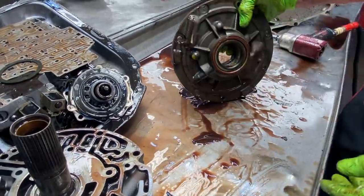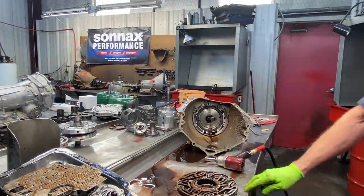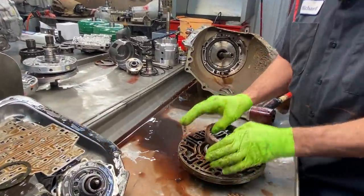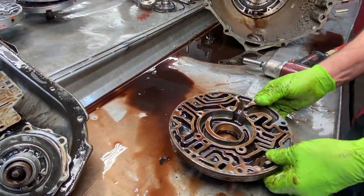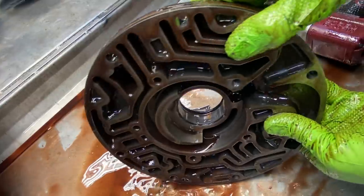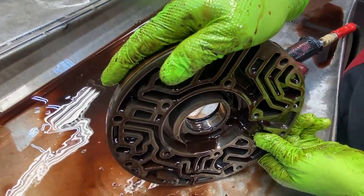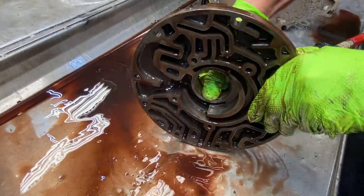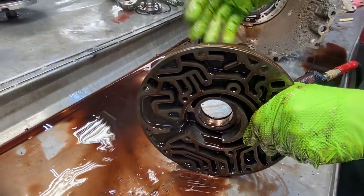This truck has got a big old 454 motor — 266,000 miles on it. We know the motor's got a lot of wear. Now look at this pump bushing — look how wiped out it is on the bottom, then come over here on the top and it looks almost brand new. That tells me the crankshaft is sitting really low in the motor, that the main bearings are worn out. The crank is coming down and pushing on this pump bushing. The crankshaft needs to be lifted — the only way you can do it is with new bearings.